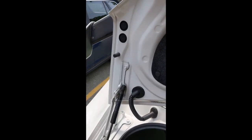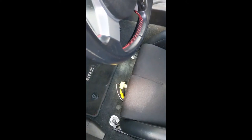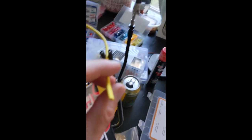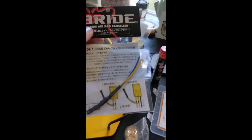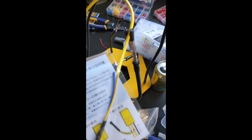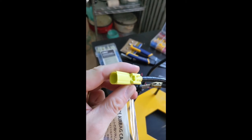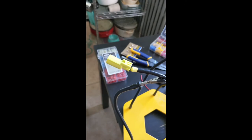We're going to plug the socket into the female end inside the car. This is what we took off the car — there's the male end of the socket, and this is the end we cut off. The Bride resistor for the BRZ is just a resistor with two cables. We'll splice that onto the cut cable end, plug it back into the chassis loom for the airbags, and then the SRS airbag light should go off.